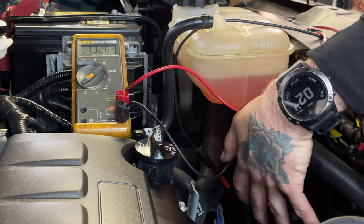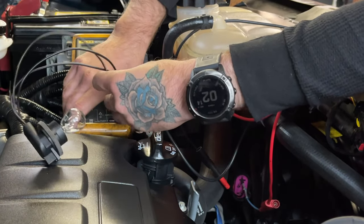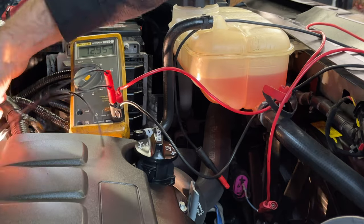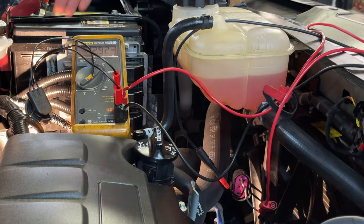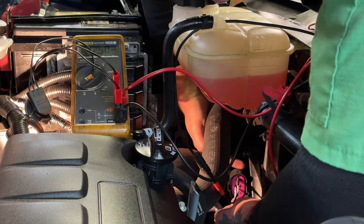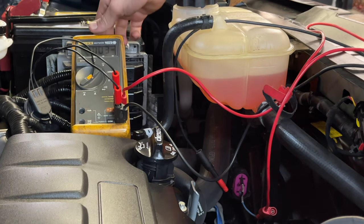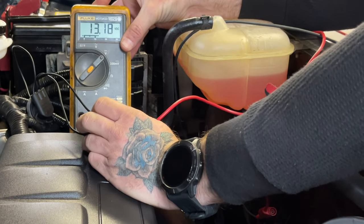The fan might be bad — I don't know yet — but we haven't loaded the circuit. So just using a little test light bulb, I'll pin this back here. You can see that lights up nice and bright. This one still at 13 volts. Let's move it to this one — 13 volts. But now if we move it to the other one — no voltage at all. You can see that: no voltage. But if we unplug it, there we go — 13 volts.